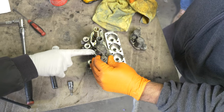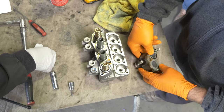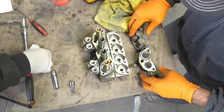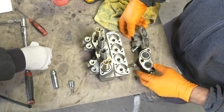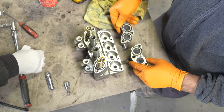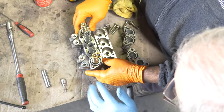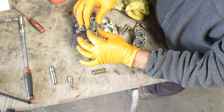Man, are there O-rings on the bottom of these guys? I haven't got three. Mine was like jelly. There's an O-ring right there. Yeah, they have. These stayed with that guy. Whoa, thing just spit. Well, they're working. Yeah, they're not frozen. All at the bottom of the modulator assembly. Make sure you have it flushed completely. Time to replace O-rings and reassemble.